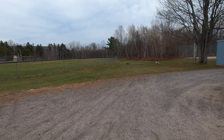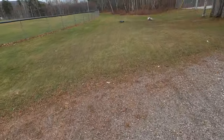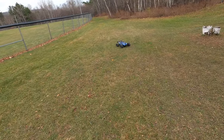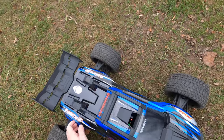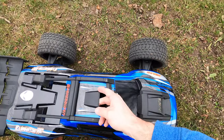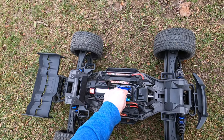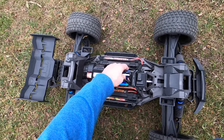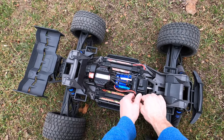Oh, we just lost something else here. Either a motor wire, because my steering is still working. Because I can see the ESC LED, it's still on, so I'm pretty sure, guys, I think it's a motor wire. Wonder if it's that center one again. Nope. All right, we've got a red LED. I actually don't know what that means. Does it mean thermal?